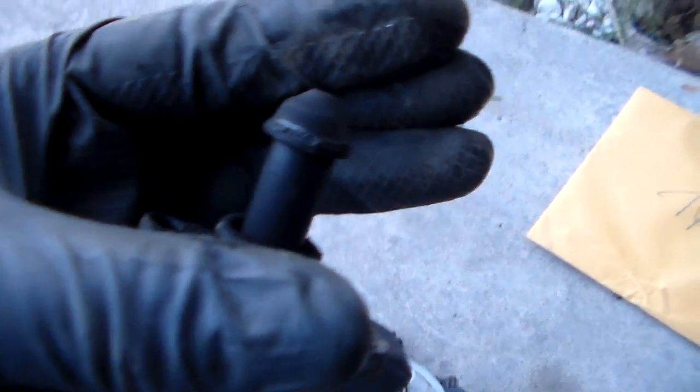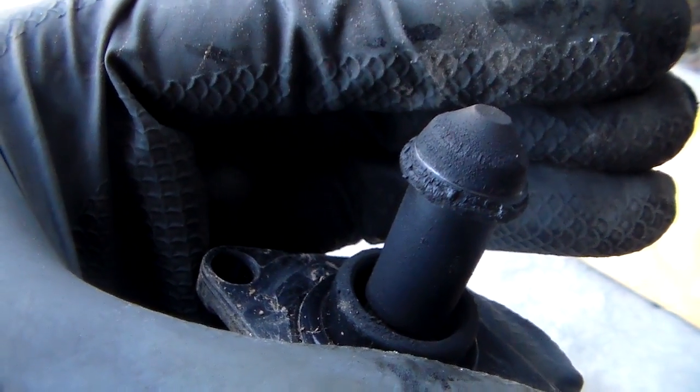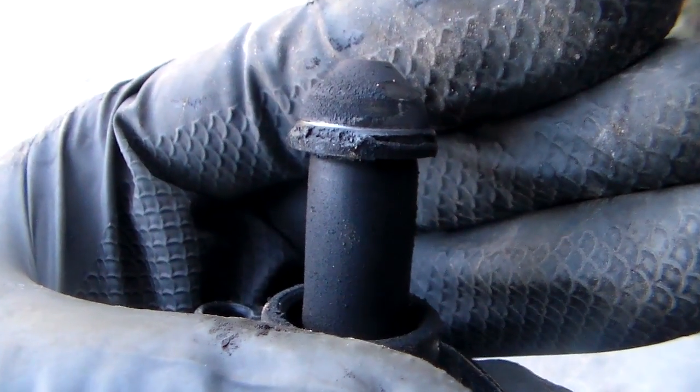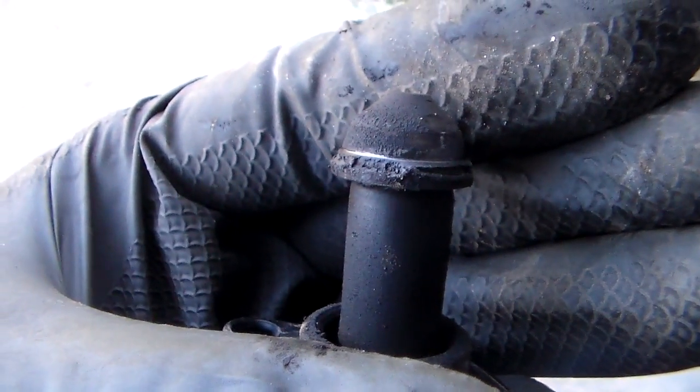If I can make it focus — it's a battle between me and the camera. But you see the little shiny ring right there? That's where this thing seats. And you see all the goop that's around it? Well, it's not supposed to be there — that starts messing with the idle air flow.